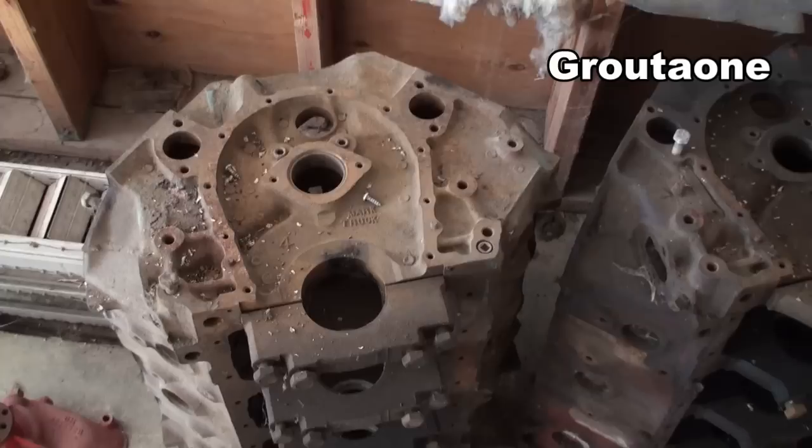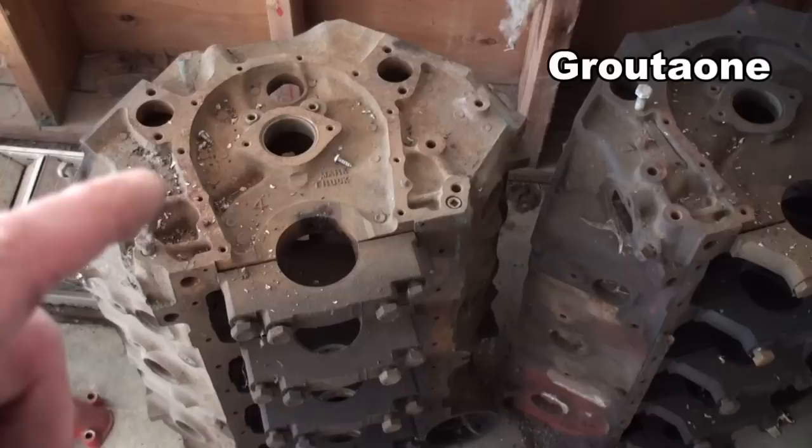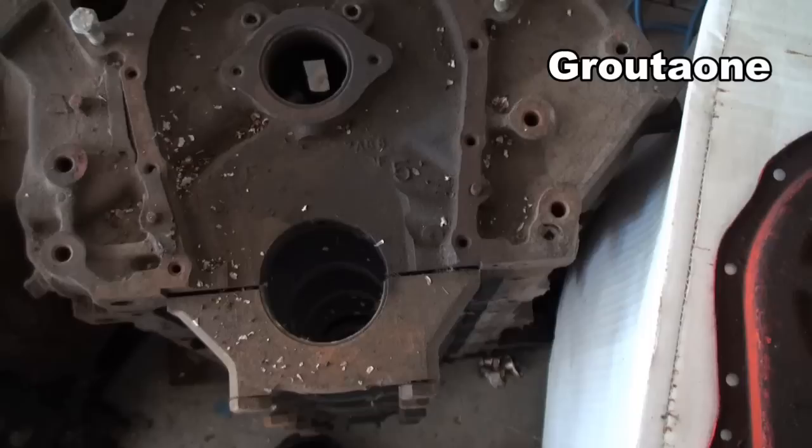What guys do now is they don't use that tall piston — they use more of a conventional style setup — but they've got room in there to put in a big stroker crank. So if you put in a crankshaft with a 4.38 stroke in this thing, and you bore it 100 over, you can end up with 520 cubic inches.